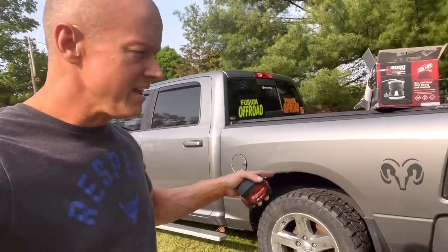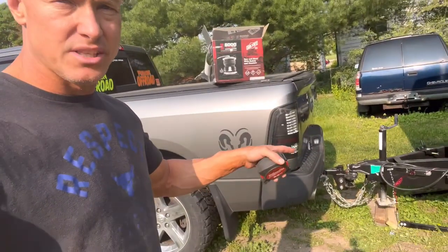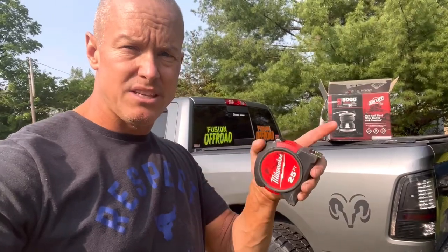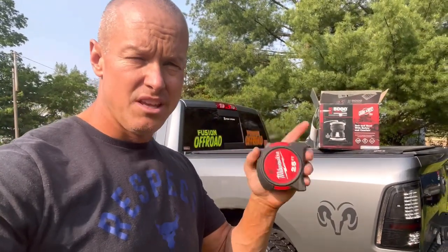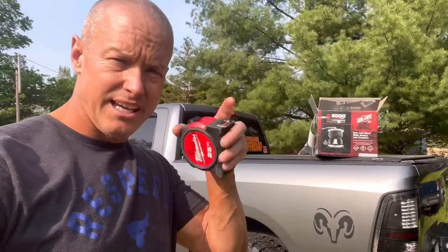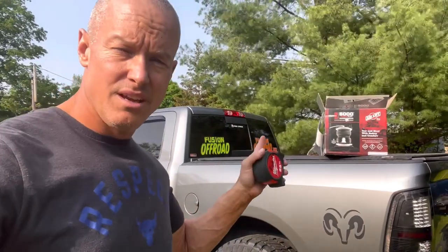With no stabilizing hitch, just the airbags, we were able to raise it up another three inches and we still have 50 pounds of pressure to play with. We raised ourselves up three inches in the back and took off the leveling hitch system — that was a big improvement and the ride is hopefully going to be a lot better. We definitely recommend getting these — the AirLift system is about $500 on Amazon, I'll put the link below. If we have a problem with them we'll repost another video, but we don't think we will. See you guys in the next one.